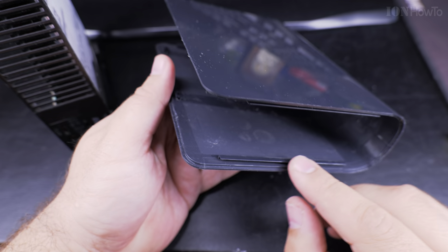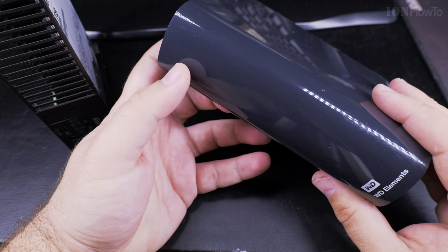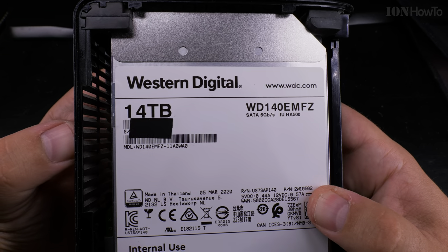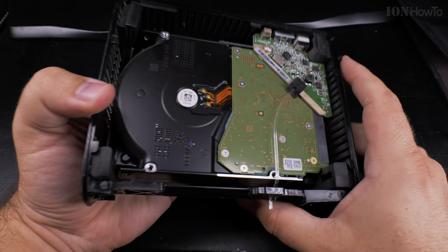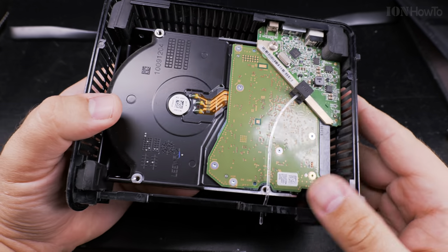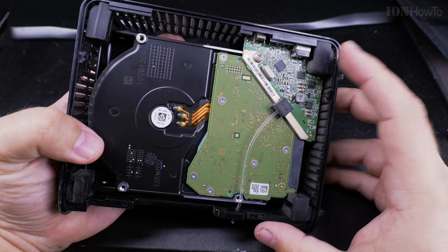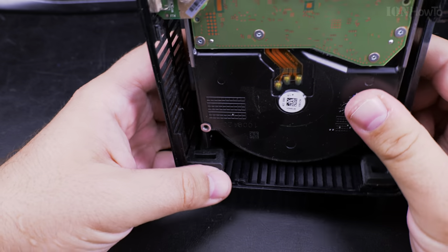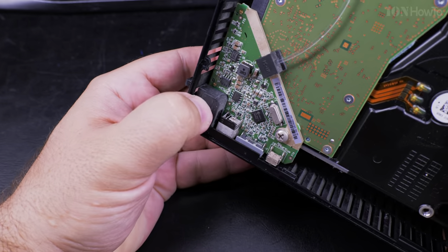You can see the rails of the hard drive on both sides, top and bottom, left and right - that's how the caddy of the drive slides in. This is the WD140EMFZ, a 14TB Helium drive. It's nice and quiet at 5400RPM. I got a new one that is 18TB and 7200RPM. It is also Helium, but it's a bit noisier and the vibrations are stronger. The 5400RPM drives are nicer for quiet and cooler operation, but they have lower transfer speeds.